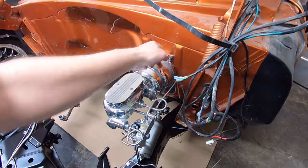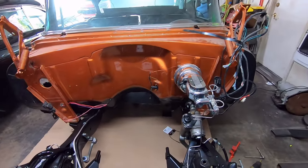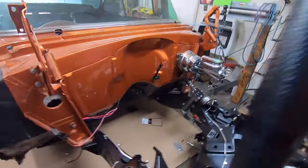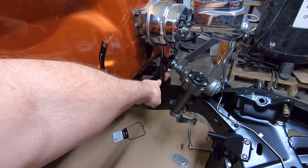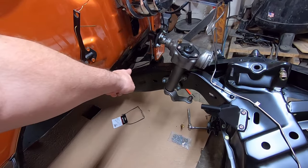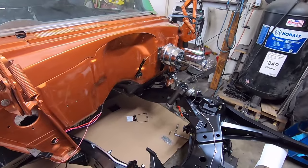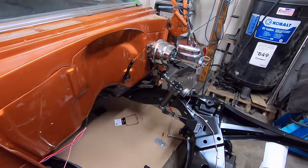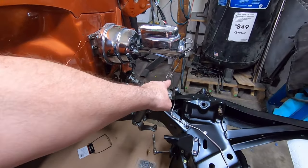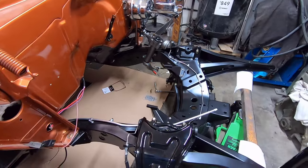The way I bent the brake line it's back up on the firewall, almost kind of hidden. You can see where I've run it down the body mount and I put a brake line clamp on the forward body mount. Then I brought it down along the top of the frame rail — it's sticking up off the rail just a little bit, not touching it — and going back to the union. It's clear of the steering column and everything, so there's easy access to work on things. That stainless steel spray paint isn't a hundred percent accurate shade to the stainless steel lines, but it's pretty close — it was bright silver before, so it's night and day.